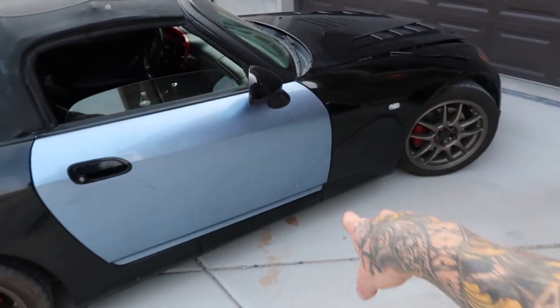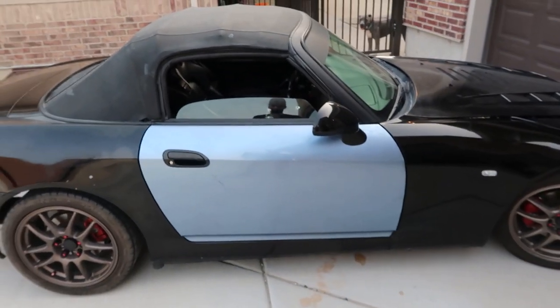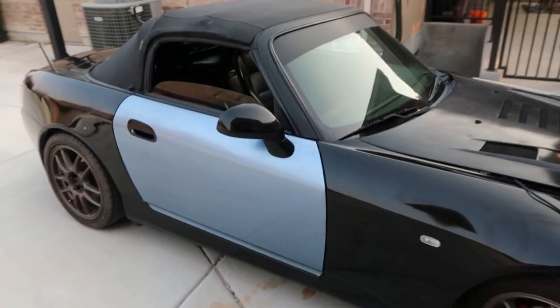I did not expect it to work that well but I'm happy with it. Once we wrap it, it's going to look fantastic — honestly perfect. So, DIY dent removal with a $50 Amazon dent kit: it worked pretty well. You have to be careful in areas where the paint's been chipped though, because the glue will just pull the paint off — so we'll need to sand that down, repaint it, and seal it. For having never done dent repair before, I'm proud of us. It looks so much better — it's as if the door was brand new.